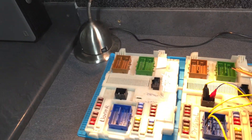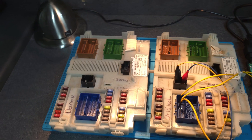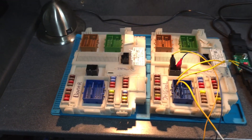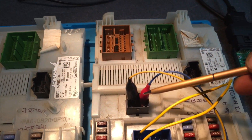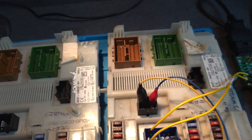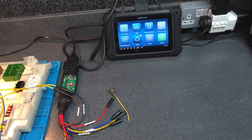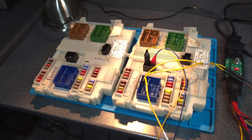I received them by post. I believe this BCM is for the Ford Mondeo or S-MAX, and another model as well. This is the wiring diagram — a very easy wiring diagram. As you can see, I have a positive here, ground, CAN Low, and CAN High. I'm going to use OBD Star today to do this cloning process.